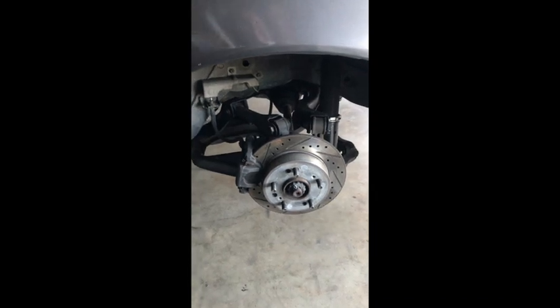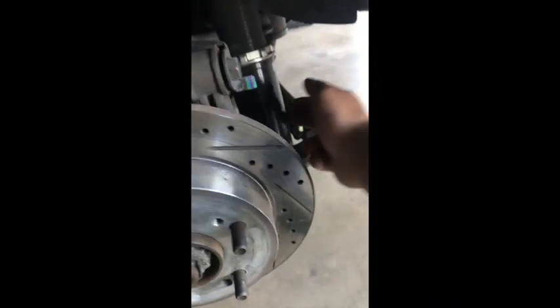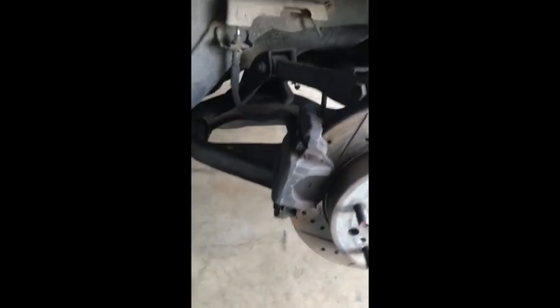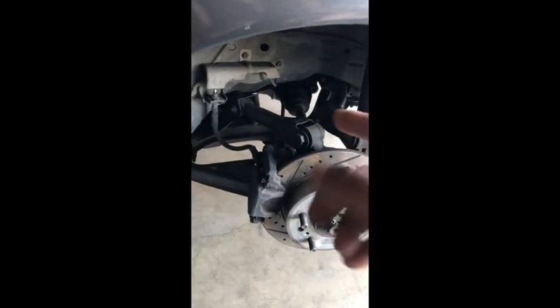So today I'm gonna take down the rear subframe. Gotta unbolt everything. Well, not really these, but I had to unbolt the calipers, the coilovers, just to drop it. And then we're gonna remove the drive shaft down there. And then we're just gonna take down the whole rear subframe so I can paint it, and also get to the fuel tank, which is under there.